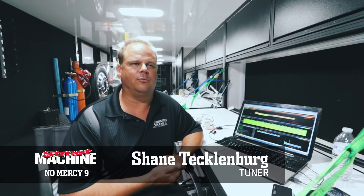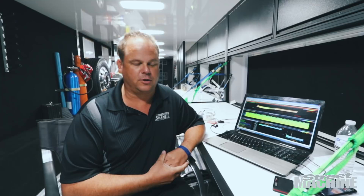I get the opportunity to work on lots of different kinds of race vehicles — land speed racing vehicles, off-road trucks, sports cars. For me, a radial drag race tire is much more like a traditional tire in other forms of motorsport, because the sidewall and construction of the tire is so stiff and so strong that it basically takes the springiness or sponginess away that you have with a traditional drag slick.